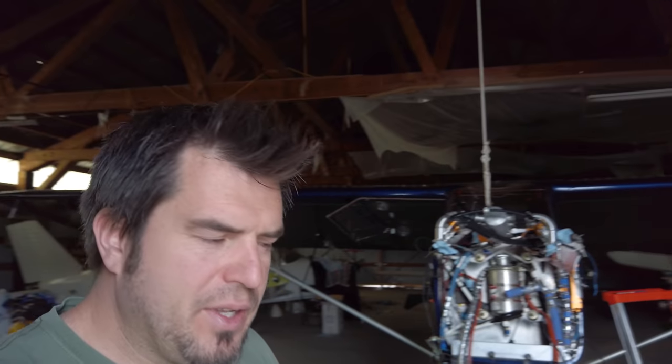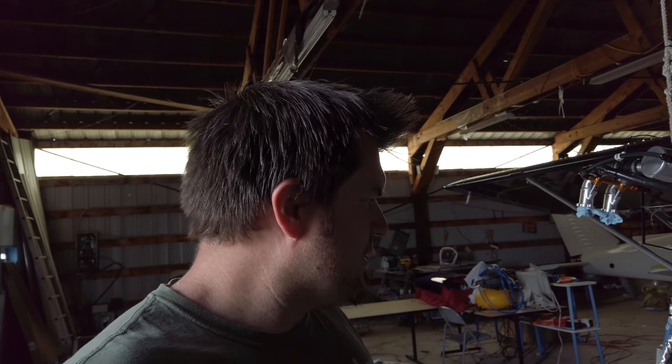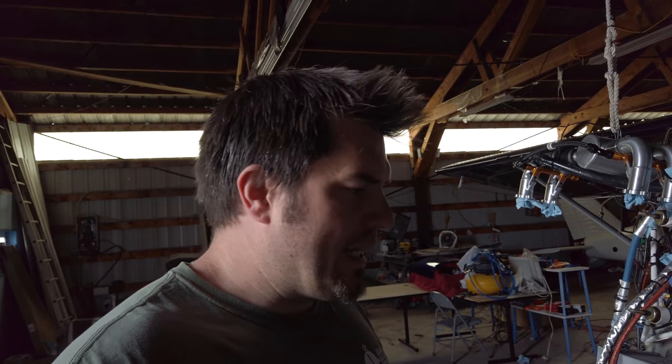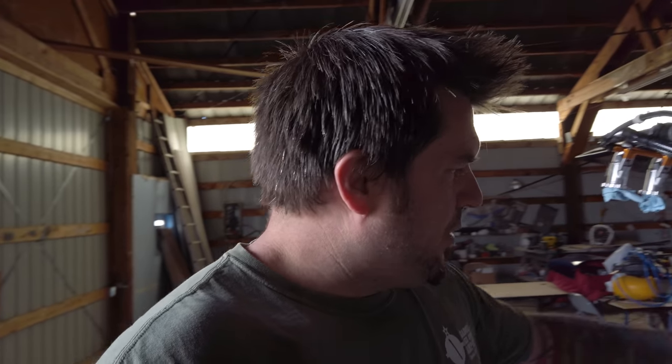Boost is a measurement of resistance. A lot of people don't realize that. They ask you, oh, how much boost are you running? Well, that doesn't mean anything unless you know the size of the turbo, what camshaft you've got, head work, cylinder size, displacement, all those things. So it's a measurement of resistance. Essentially we'll be able to make the same power at a lower boost because there's less resistance to the engine breathing, both getting air in and getting exhaust out. So all that comes into play.